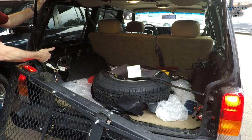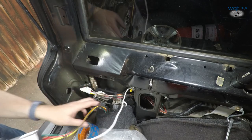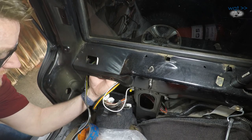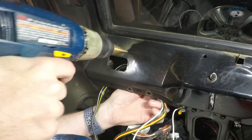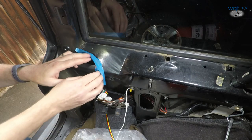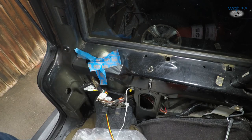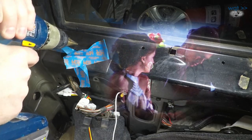Last step then is to go ahead and install this permanently. Let's figure out roughly how this is going to mount under here — it's a screw hole, which I'm not going to make exact, but it's going to be somewhere right about there. A little tip when you're drilling: magnets and tape can be two great ways to help keep filings from going just everywhere when you're working with steel. If it's aluminum, then of course the magnet's not going to work, but the tape still will. I just really hate steel filings because they get in everything.